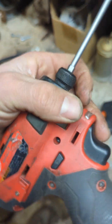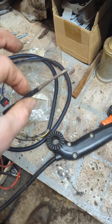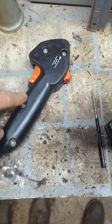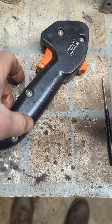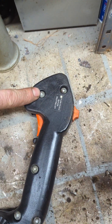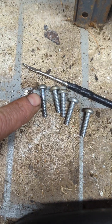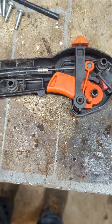I'm going to show you what you need to do this. There's a T27 Torx and you just need some kind of little tool to wedge the wires in there. You've got one, two, three, four, five screws. This one's longer and has a smooth shaft — it's for the actual trigger, so that's the only one that needs to go back in the same spot. All the other ones stay right there. Got them taken out.